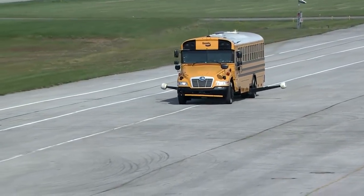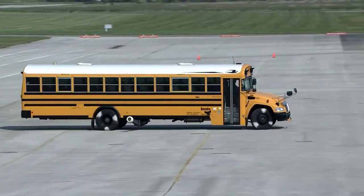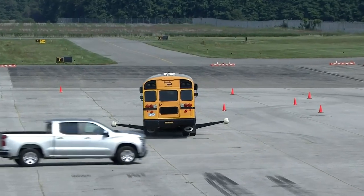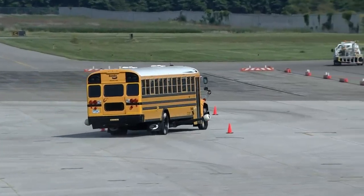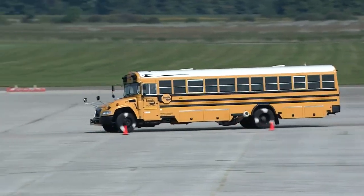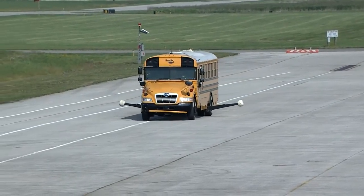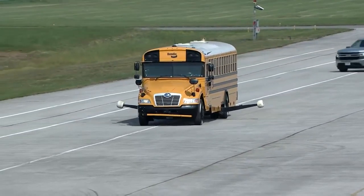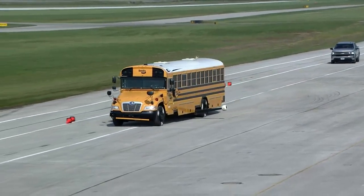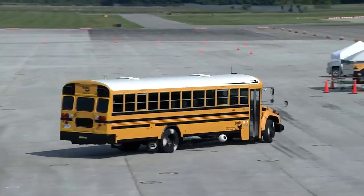I'm going to come around here, turn that system back on, and we're going to come in. I did about 20, 25 in there — let's see if we can get 30, 35 with the system on. Again, this is Bendix ESP. We're on a Bluebird bus right now with stability control. Here we come in about 30. There it goes. So the system is reading what's going on — driver intent through the steer angle sensor, and then the yaw rate sensor, going the vehicle direction, and lateral acceleration, feeling that shift in the center of gravity — sometimes what you feel in your car when you go around a really sharp turn. We're going to come back around and check out that instant replay. Back to you, Mike.